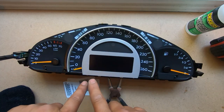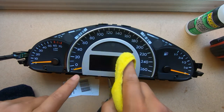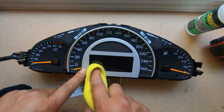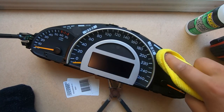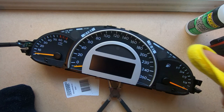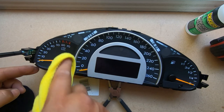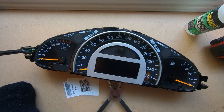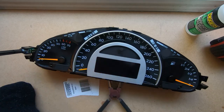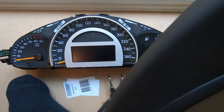Then stick it down. There is going to be a little bit that does not stick properly because of the VDA symbol right there. I then line this up here and push it straight back down so it sticks back on again. That's it — it's clipped on now, completely flush at the bottom. Now we get our microfiber cloth and clean everything so we do not have any fingerprint marks or dust. Always make sure that you do not touch your pins, and if you do, make sure that you reposition it where it belongs. Then get some air duster and spray it all out — we want to clean all this as well.